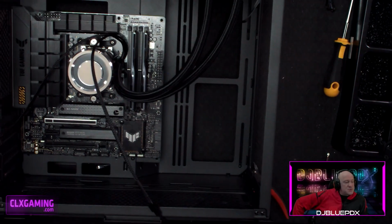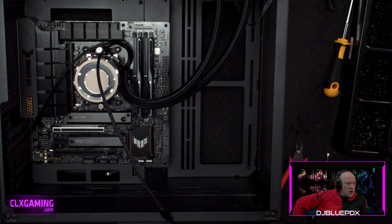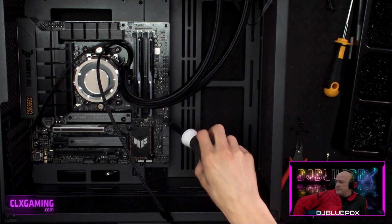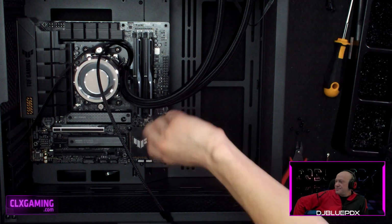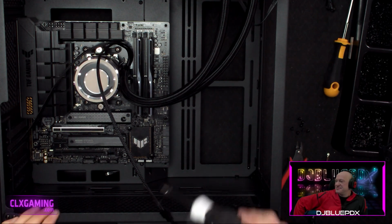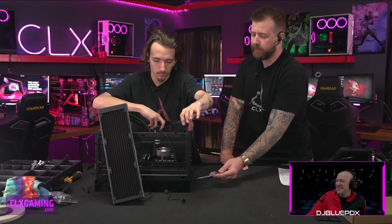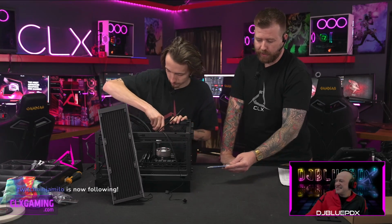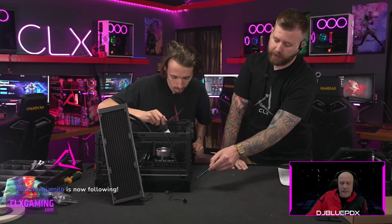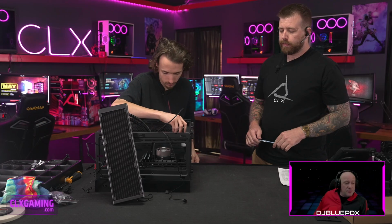And this still applies with a 2/3 case, which I really like. So what do we mean by 2/3, Paul? Yeah, so what that means is our motherboard is sitting 2/3 of the way down, as opposed to all the way down on the back of our case. So that leaves us some room in the back for a power supply and any 2.5-inch or 3.5-inch extra hard drives in this area. And why that's beneficial is none of the heat that's generated from those components will be in the main body of their case. They'll get their own fresh air in from the back and exhaust out these holes where you see me pointing to now. Yep. And that's what I got for my PC.